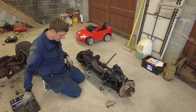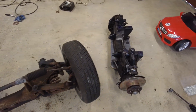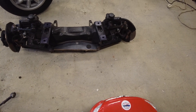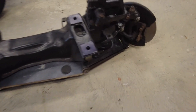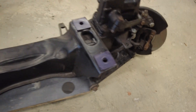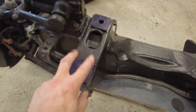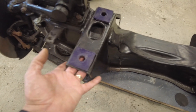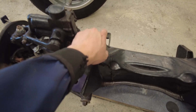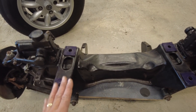Let's take our bolts here out so they don't disappear on us. I'm going to put all the hardware in a bag and label it. As you can see there's the old crossmember out on the ground and here's the new one ready to fit. I have all the fasteners tightened and split pinned as necessary - I had to do the ones down here as well, I think they were 45 foot pounds if memory serves. You'll see there are polyurethane pads on the tops of it.